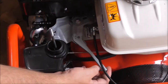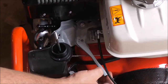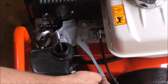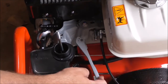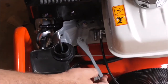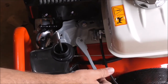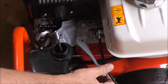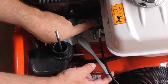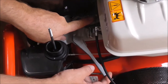This lever right here is a throttle control lever as well. Since we have a remote throttle — which is the throttle lever at the handlebars — we don't utilize this to regulate engine speed, but note that it will regulate engine speed. That's the low speed position and this is the high speed position. When you move the throttle lever on the handlebar, the cable is going to pull against this right here where it's fastened down — there's a screw on it. Some engines have a Phillips or flathead screw.